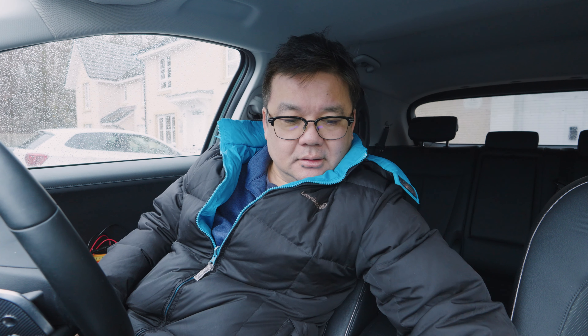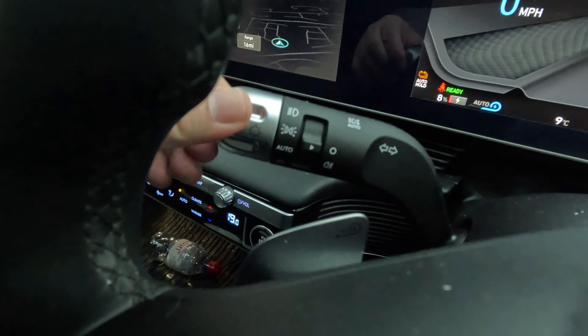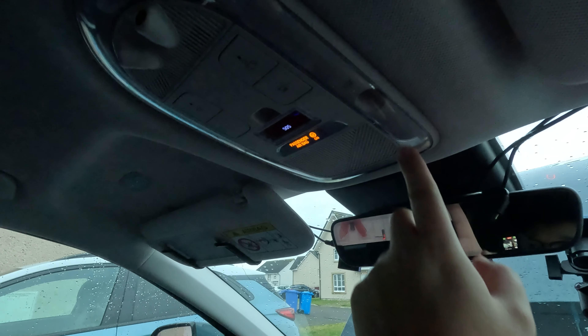It's day two. The car has been charging overnight and it's up to about 54 percent on the traction battery. The 12 volt is at 12.5 volts with the car off and 14.5 volts with it on, so it's definitely working correctly now. Going through all the scenarios — the long drive, the lights left on manual — none of those explain it. There's no reason for the 12 volt battery to die apart from it simply not being a very good battery.